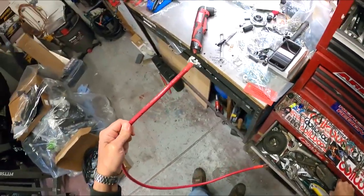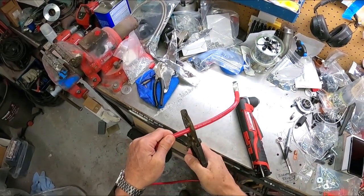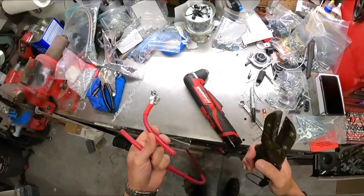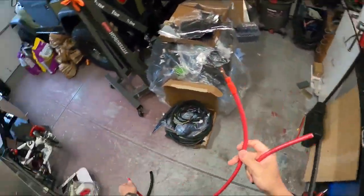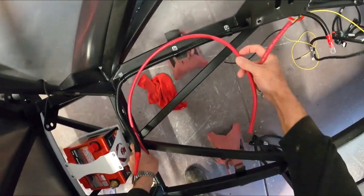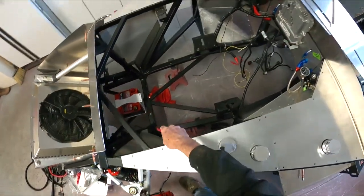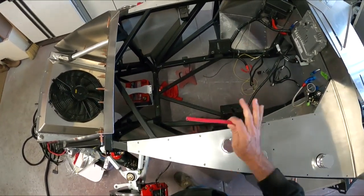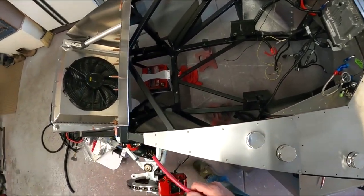People always wonder how you cut battery cable — they make special cutters for it. I've got a set of these Craftsman handy cuts; they actually do a really good job. You just kind of work it around and they snip right through it, no issues. Easy way to do it. So this one here is going to tie into here and wrap around, then tie up into here also. That way I've got ground there and ground there. Everything ties in here, alternator comes here to here — it should be a very clean simple look instead of having all these wires going to solenoids.